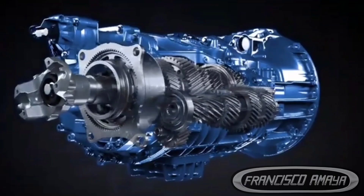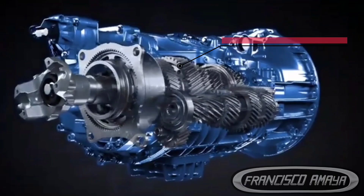What is the main shaft sensor? It's the one that reads the main speed from the engine all the way to the transmission. The clutch sits between the transmission and the engine, so the main shaft sensor reads the speed powered by the engine. If the engine is at 600 RPMs, the main shaft sensor should also read 600 RPMs — pretty basic.